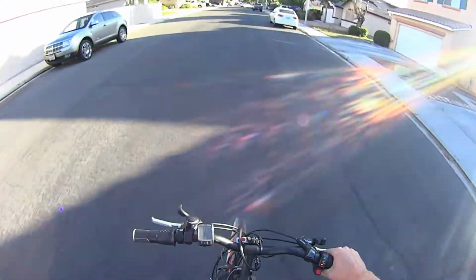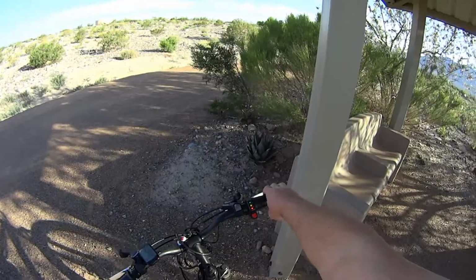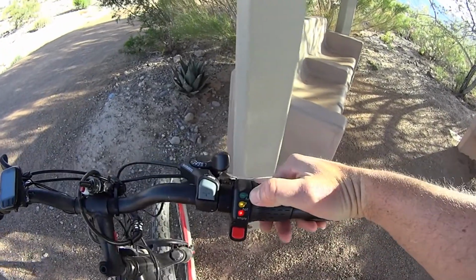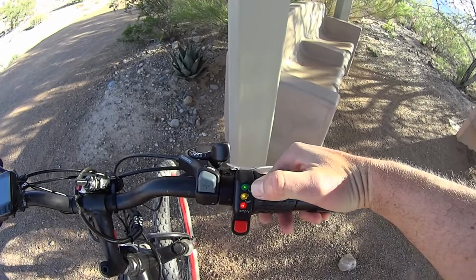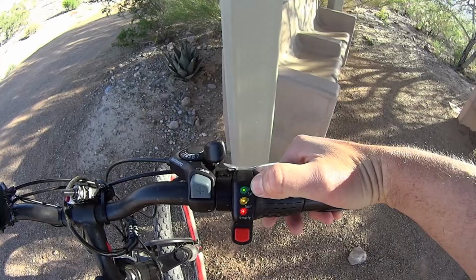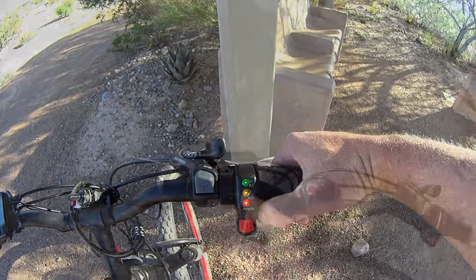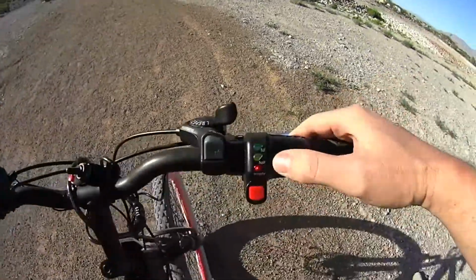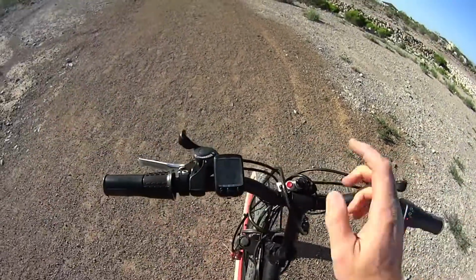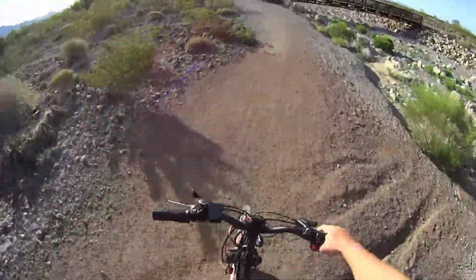So these batteries don't have the amps of the big ones. We are at mile 2.5, and I just realized that when I let the throttle go, the green light is not coming back as fast as it was before. It's coming back right now, but this is reading lithium ion. Lead acid has a lower voltage. Mile 5.5, I have lost the yellow light. Now remember, the voltages are different on this one, but I do feel that the bike is going slower. And there it is, throttle.